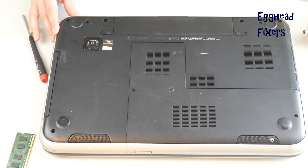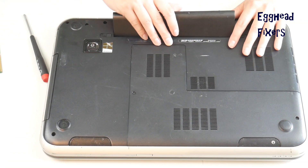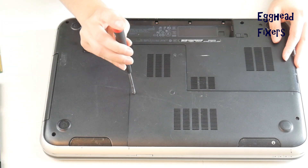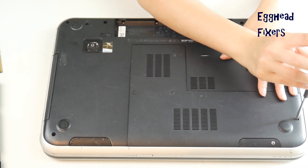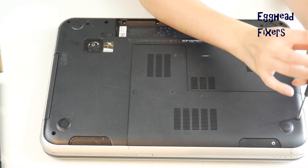We do the same method but we're going to try removing the other stick of RAM. So take your battery out, unplug your computer, and go back into that easy access panel. As a quick note, occasionally the problem is that your RAM is loose, so you may just need to reinsert both RAM sticks and see if it turns on. This is a less likely scenario but it's always worth checking.